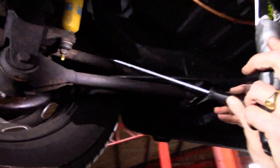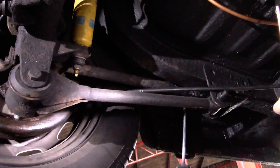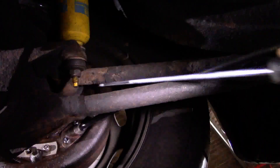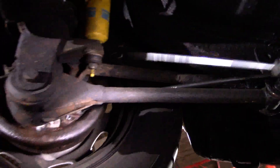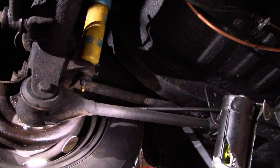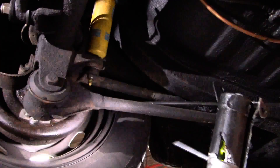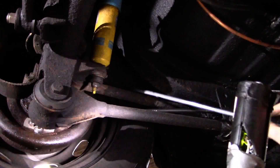Then we have the symmetrical linkages. This upper link is outboard and attaches from the shell horizontally aft to the leading edge of the axle — that is what Volvo term a support arm. It has two small bushes, one at each end. These can either be hourglass-shaped or purely cylindrical bushes.